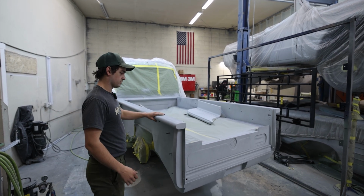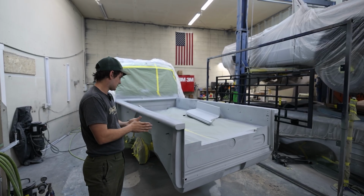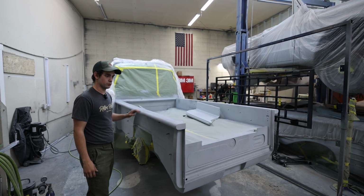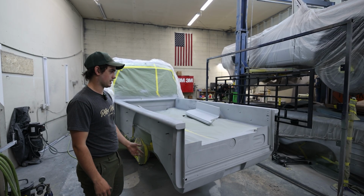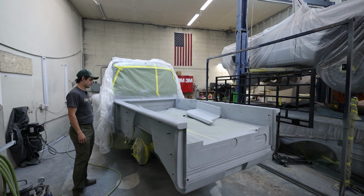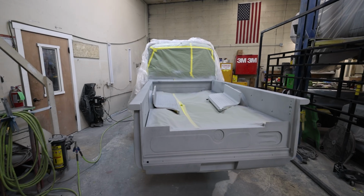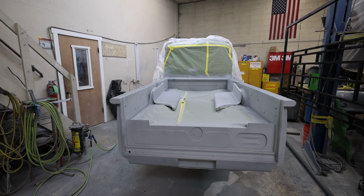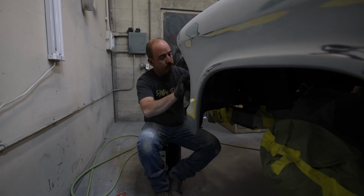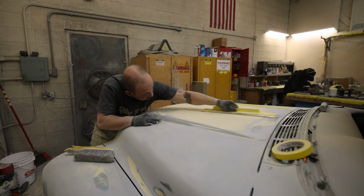And we got the bed primed. So this is our first, we throw a couple coats of polyester primer down, bodywork on top of. And so what we'll do is we'll come in and we'll 120 that, we'll find our lows, we'll skim it, bodywork it, make sure that's really nice, and then that'll go into build primer, and we'll sand that down. That's what EJ's doing here on the front. So it's shaping up, but bed, bodywork soon. We'll probably end up throwing the fenders back on it just to see exactly where everything needs bodywork. Get it super nice, but not over bodywork.